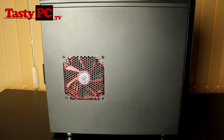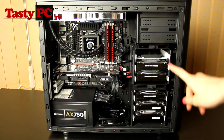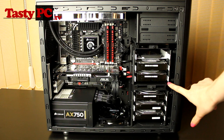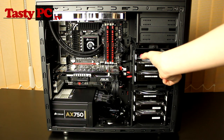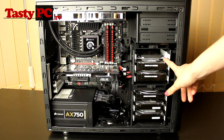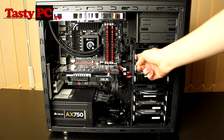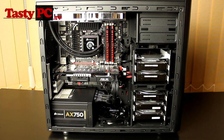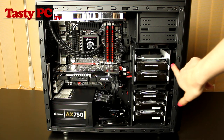What I'm going to do now is turn off the camera, move the light around so you can see inside the case properly and then show you around the inside of the case. Looking around the inside, we can see that it supports a micro ATX motherboard. We've got the two 5.25 inch optical bays that I mentioned and two hard drive cages with six removable hard drive trays. To remove them you just squeeze this bit and it pulls straight out and slides straight back in — I would show you but I've got all my hard drives already connected. These can support either 3.5 inch or 2.5 inch hard drives or solid state drives. One thing I did notice is when you are taking these out and putting them back in, it does leave white paint on the inside of the cage, but you can't really see it so it doesn't really matter. This top cage is removable — you can take it straight out or you can actually put it in the other way, and some people would prefer to do that because it better directs the airflow from the front of the case to the graphics cards.